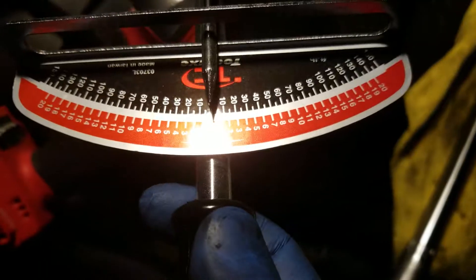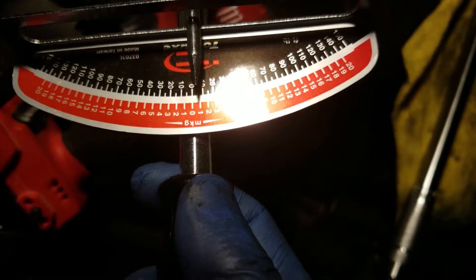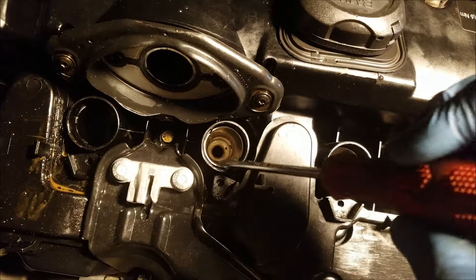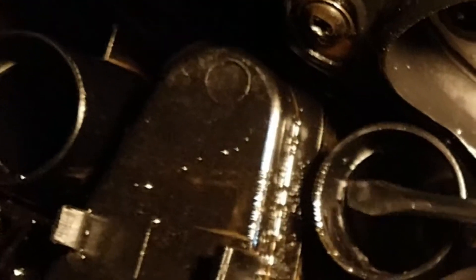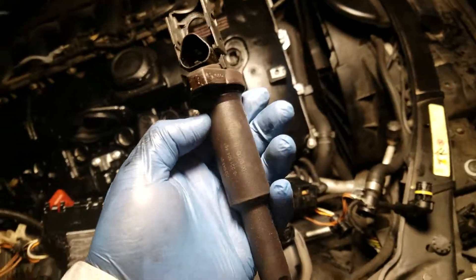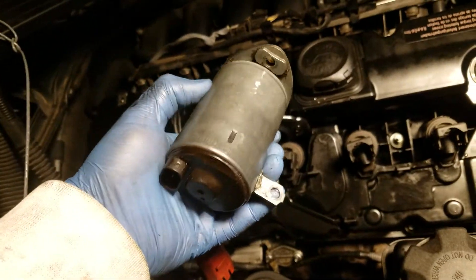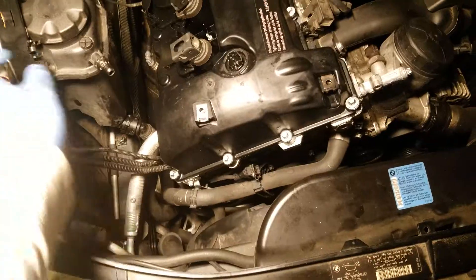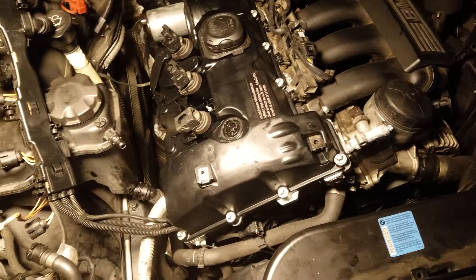Now we can torque it — watch the needle and stop right there. Put the metal jackets back into each of the spark plug holes by pushing them in. This lid needs to set between the two edges in the little track, and it should click in. Next we do the spark plugs, put the coil packs back in, then flip all the cables back over and attach everything back in place.